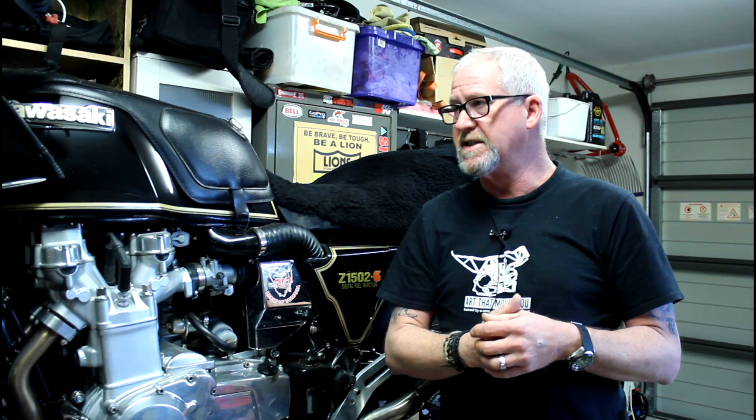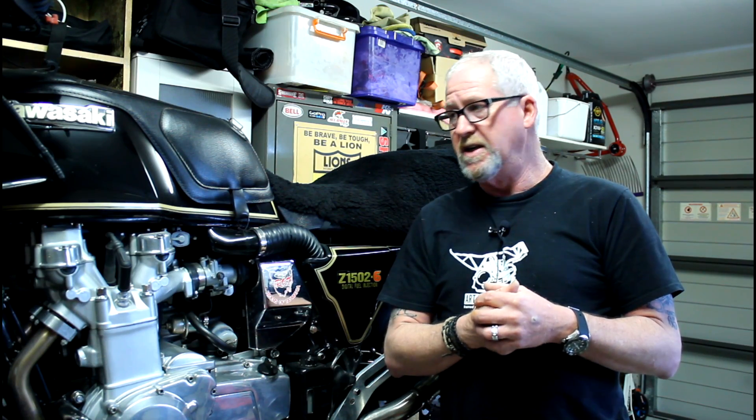Minimal, but they do get some gains. But yes, it is a cold air intake, which means that you will lower the charge temperature of your fuel-air mix, which means that it will condense more into that volume and you'll get a bigger bang. So cold air intakes are always worth doing.